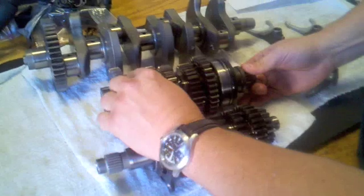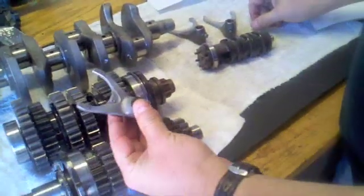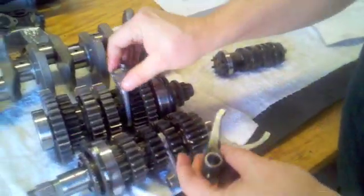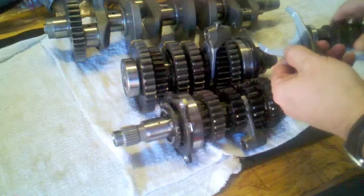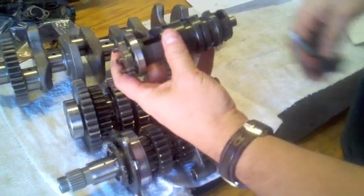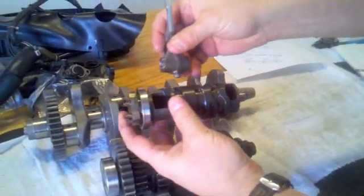Using the shift assembly, you can engage the drive wheel on either side. There are two different gears on the drive shaft — you can engage this gear or that gear depending on which way it's being shifted. The way these get shifted is through shift forks. There's one that sits on the lower drive assembly between third and fourth gear, and then there are two shift forks that sit on the drive axle. All of these are controlled by the shift drum, which is a cam-actuated component.